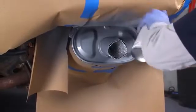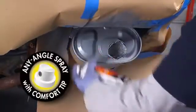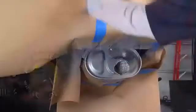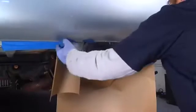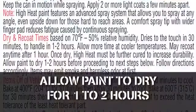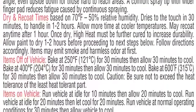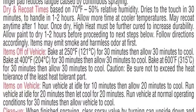One thing you'll really appreciate is our Any Angle spray technology that allows you to spray even with the can upside down. With the exhaust and muffler painted, we now come to the key steps: baking and curing. You need to allow the paint to dry for one to two hours before baking. For this exhaust system, we will, of course, bake it on the vehicle.